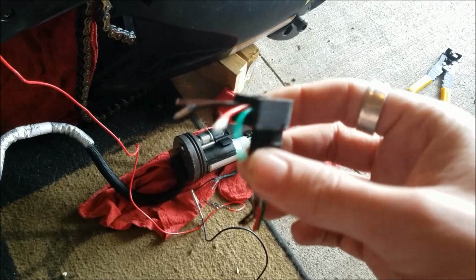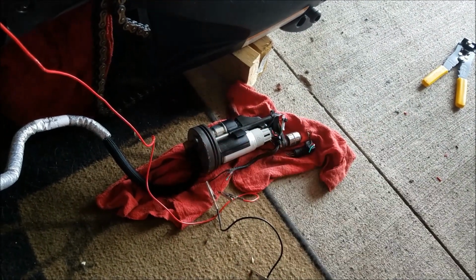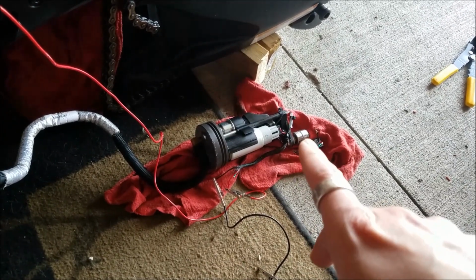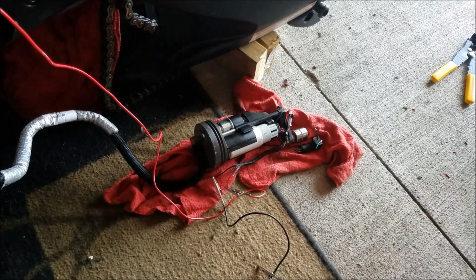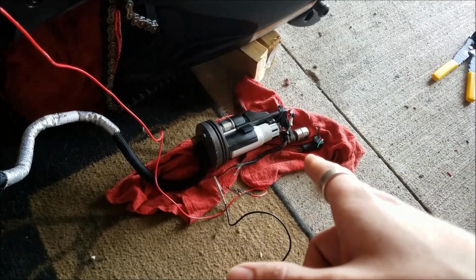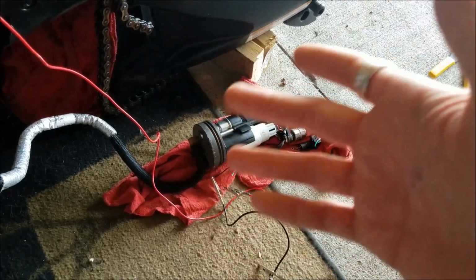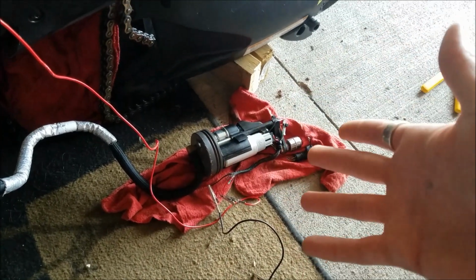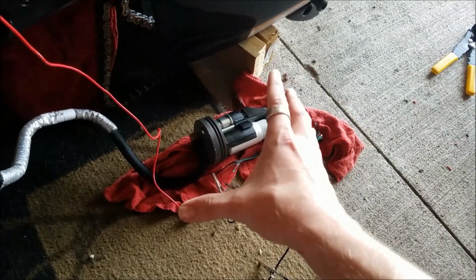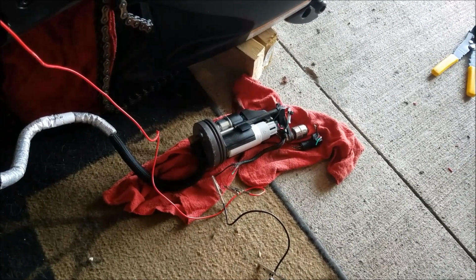So hopefully this video shows other people how to diagnose some of this stuff and the means to go about it. And yeah, at this point, a majority of people will probably just replace the fuel pump, but instead of spending $400 on a new fuel pump, I spent $60 on an aftermarket unit that I'm going to be putting in, and then $5 for the gas resistant shrink tubing. I already have the solder, all that stuff. So basically, all in, also new O-rings, I'll probably have $70, including the new float, for this, I guess you'd say, a refurbished fuel pump assembly.